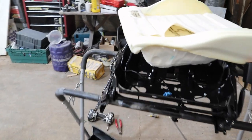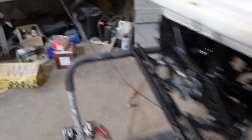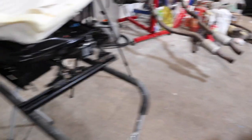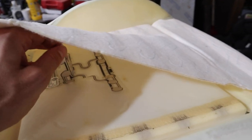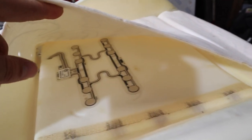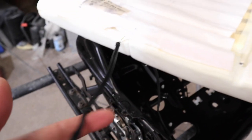As you can see I've had to completely strip the seat to get to the sensor. The backrest came off first, which meant all the side trims had to come off — that took about 20 minutes just for one trim. Then to get the seat cover off I had to completely remove it because it's held in with four hooks in each corner. This seat actually has heated seats, which could be an option for the future owner. Here is the sensor — it's under the heated mat, just stuck on with some adhesive. That's what we are swapping out, so we are halfway there.